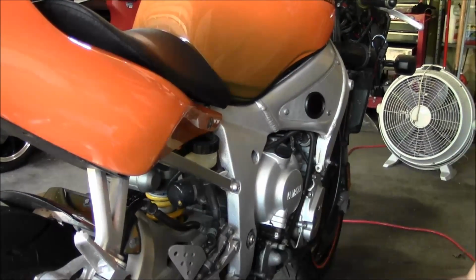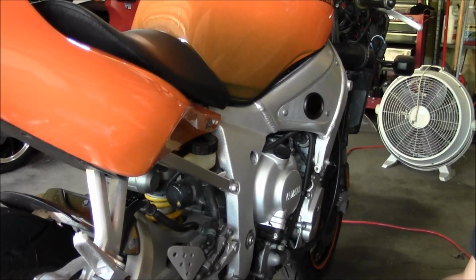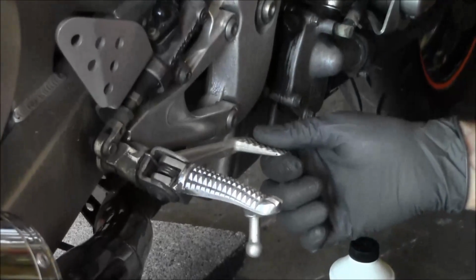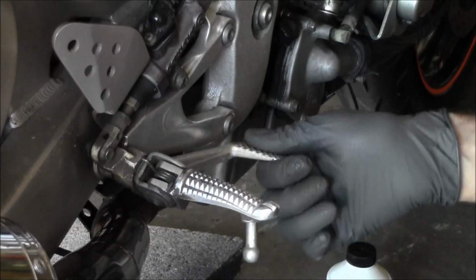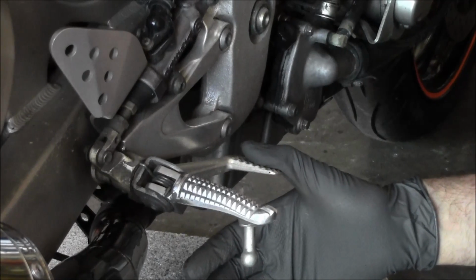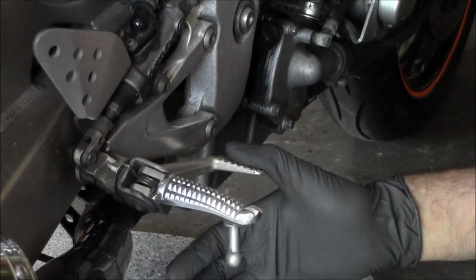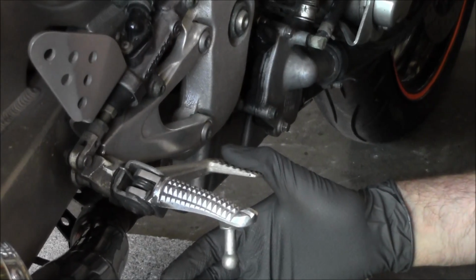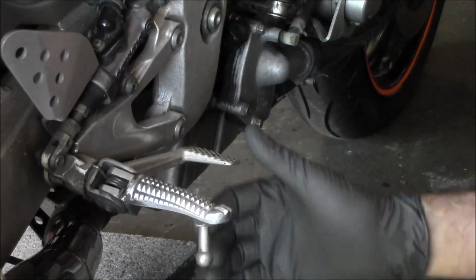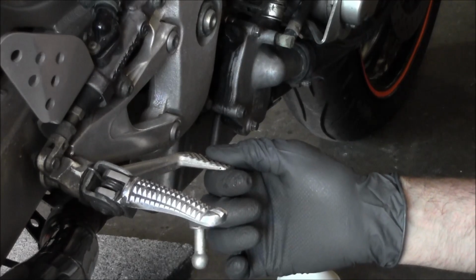So basically what's gonna happen is I'm gonna pump this lever 3 or 4 times. I like to do this with 2 people. I'll say pump. The person who's helping me is going to pump this 3 times. On the last pump, they're going to hold pressure and say to me, holding. That's going to be my cue to crack that bleeder open. So once that bleeder opens, this lever is going to go down further. Once it bottoms out, they're going to say down, and they're going to keep holding it down.